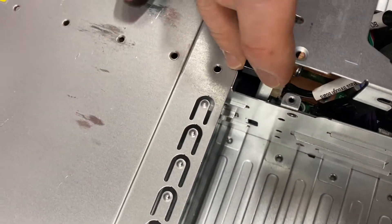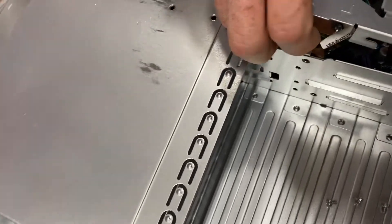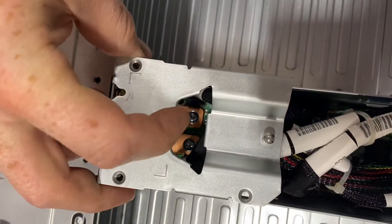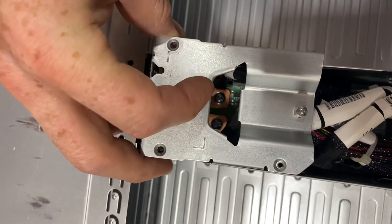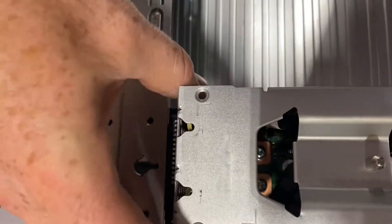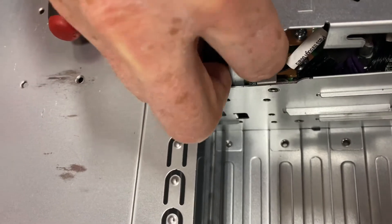On the way back in you'll notice there's some resistance — it's this little cable. The cables to the power pass-through board, which is the board connected with the big copper connections, you do not have to take that off. The whole unit rocks out. When putting it back in, just be sure you put your finger here so you can clear that little tab with the cable.